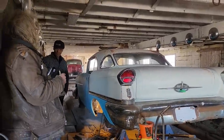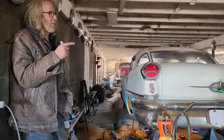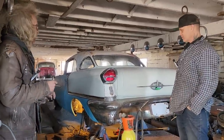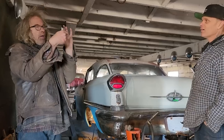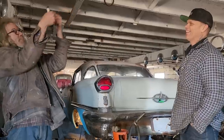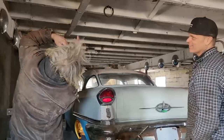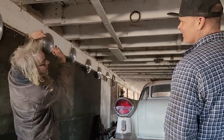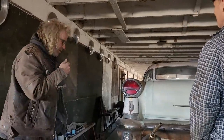It took a little bit and then I decided to go with my first patch — I made it, drilled the holes, put the rivets in, and then I tried to weld the side of it. That's when I discovered I was just melting it away — way too thin, like paper thin — so I had to go to the smaller tip. Then I found I can't weld a lap weld facing away from me two feet away. I have to get underneath, put my head on top of the leaf spring, and there's just enough room between the inner fender and the bottom of my glasses to see the edge of the patch so I can weld towards me.